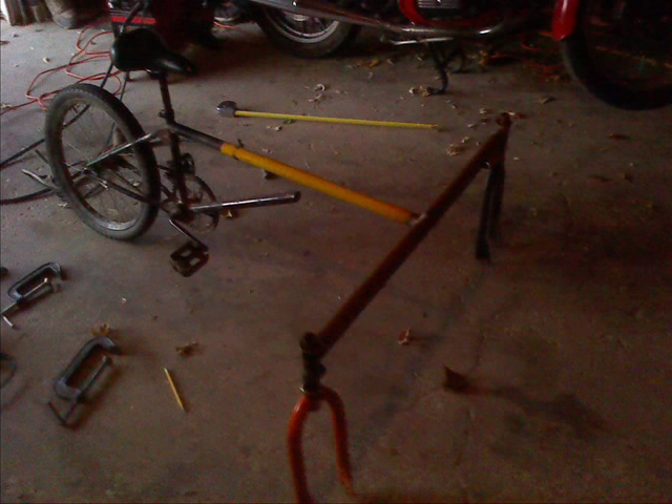I used a hunk of metal I pulled from the trash that's about two inches in diameter, connecting this to the main portion of the 20-inch bike by using a piece of clamp light stand, or work light stand — the yellow portion shown — to hold it all together. This also happened to fit directly over the main black beam from the 20-inch bike, allowing me to move it forward and backwards to adjust the overall frame length until I finally welded it into position and secured it again with the second portion of clamp light frame, or the second yellow piece on the lower section.